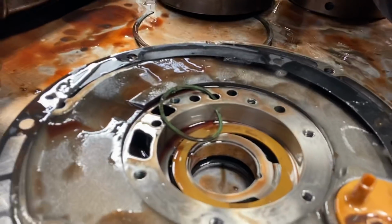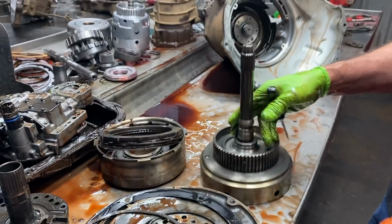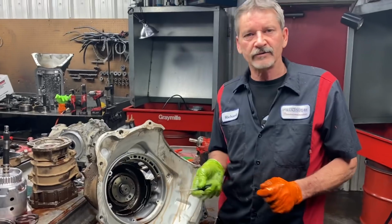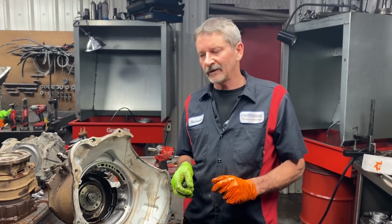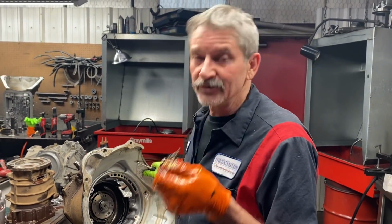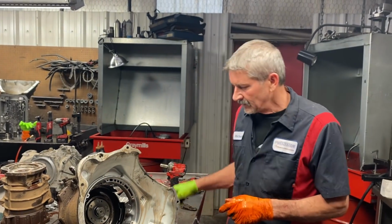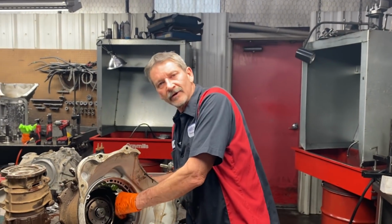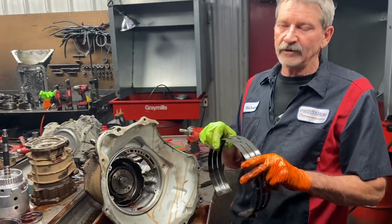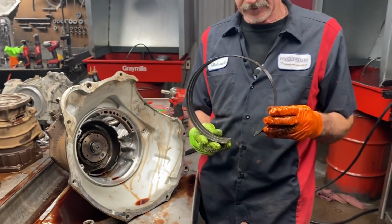Now if you're truck sled pulling, stuff like that, and you're gonna take your tranny apart and look at it all the time, then yeah, that's how you do it. But being that this guy's gonna work this truck out in the field, you can't crank the pressure up that high, because that's what happens. When you eat a high pressure ring up, you know the pressure's too high. Put a gauge on it, look at it, and see. That's another reason why carryouts are so critical. When we do a carryout and we give it to you, you don't go home and put a gauge on it, but we do. So that's why we know what overkill pressure is and all that type of stuff.